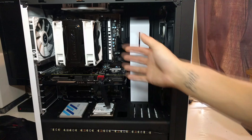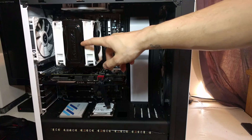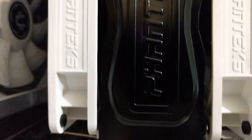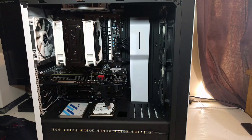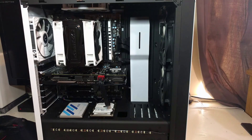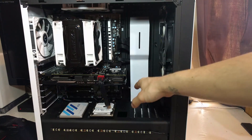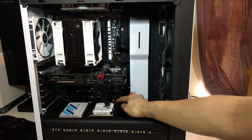Up at the top, cooling my quad-core processor running at 4.6GHz, I have the Phanteks PH-TC12DX — all in white and black, which I really like. For RAM, I've got 16 gigabytes of HyperX DDR3 running at 2400MHz, although with my overclock I'm not able to push it higher than 2133MHz. I've also painted one of the sticks white and will do a video later in the year showing how to paint RAM without removing the heatsink. All the cables are nicely managed thanks to the lovely cable management shield on this case.